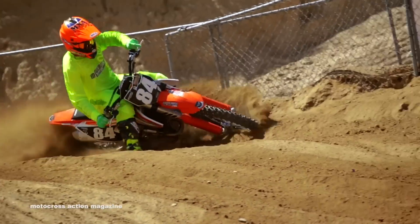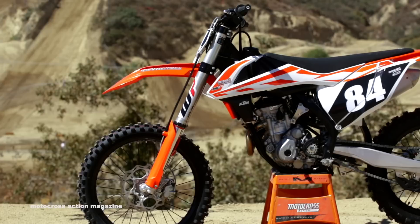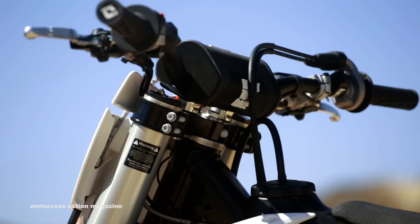As we all have heard by now, the biggest updates to the KTM SX line are the WP48 air forks. These forks so far are some of the best forks on the market and have been a huge improvement over the 4CS forks. With the 4CS forks, they were supple up top, but as soon as you got deep into the stroke, they would bottom out.